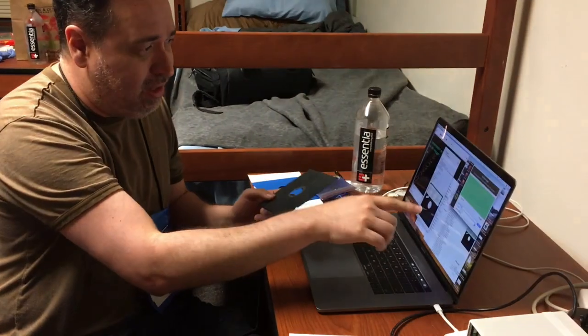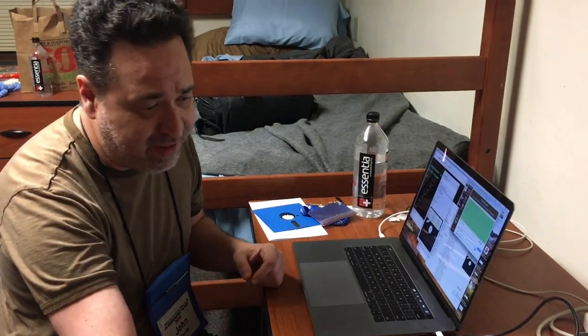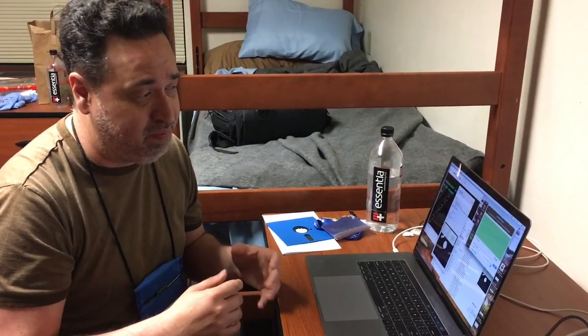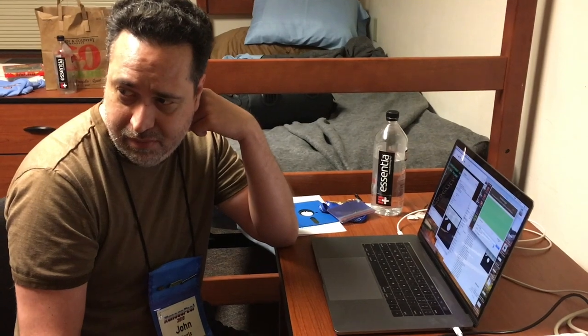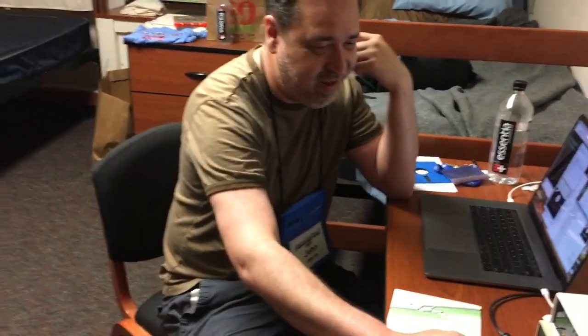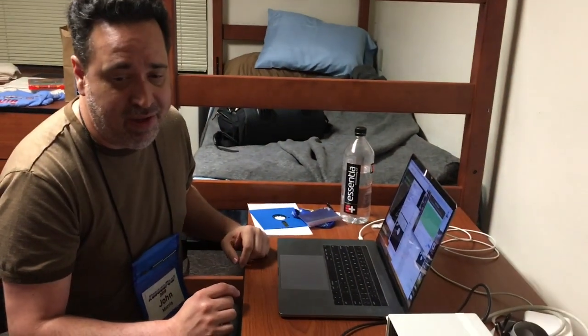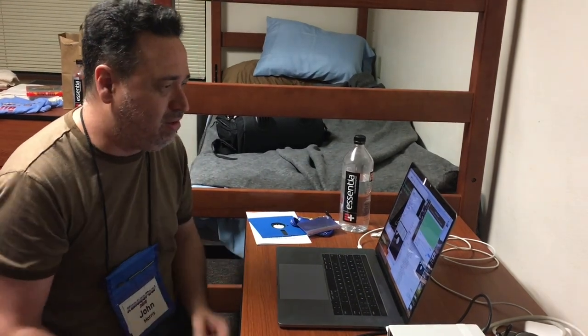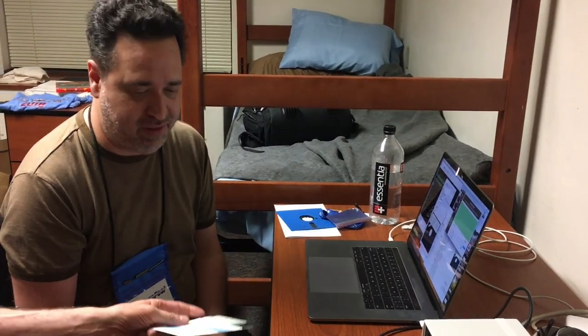You can retry the bad sectors and it'll keep any data that you've already accumulated and then just keep working on it. We've had disks that were really in bad shape — just really mildewed and stuff. Couldn't you build a version that would read eight-inch disks and have the government pay huge amounts of money to re-access data? Probably. How many times does it try? Well, it'll vary — for direct disk reading it'll do ten retries before it tries to come up with more complex data recovery.